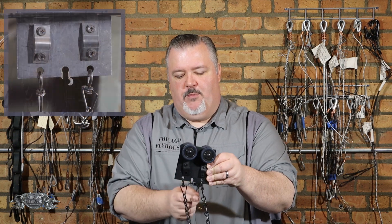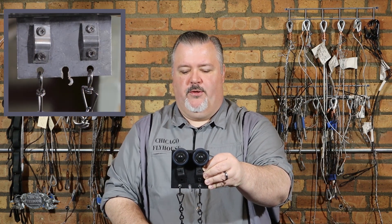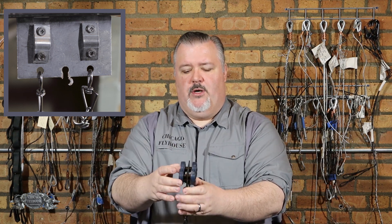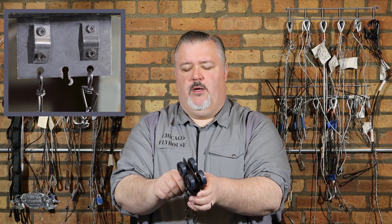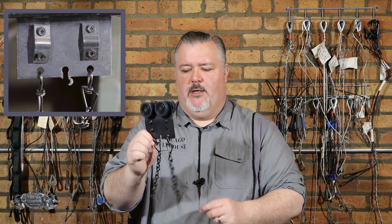It was much less exciting to watch the master carrier break. We pulled on it and it just snapped out the bottom of the circle there. But again, at about 1,900 pounds — because we had two axles — we don't see any real deformation, although there's just a tiny bit. Probably this is still a working master carrier, except that we've punched out that middle hole.